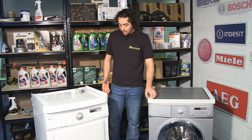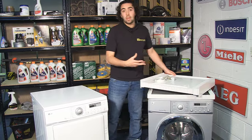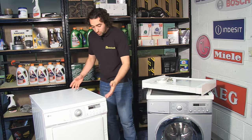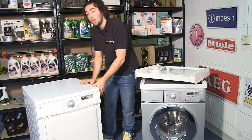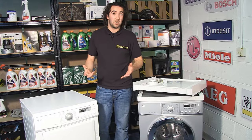The first thing you need to do to get stacking is remove the legs from the tumble dryer, and this is to stop it from wobbling once you've got it up on top of the washing machine. If your tumble dryer is fairly lightweight, such as this one, you can usually just lean it to one side and unscrew the legs from the bottom. However, if it's a heavier machine, we recommend you lean it all the way onto the floor onto a piece of cardboard or material where you can unscrew all the legs in one go.